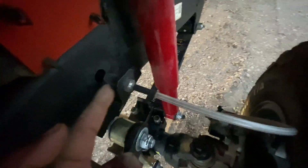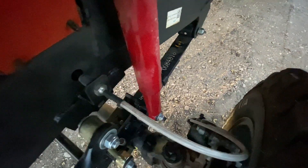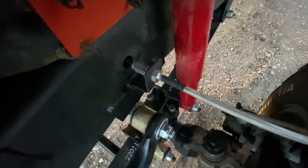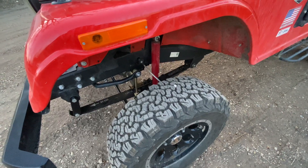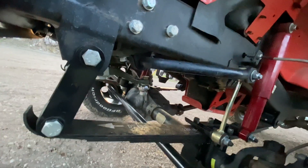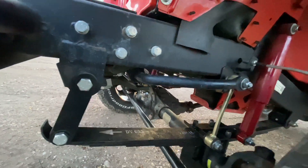Brake lines were a bit tricky. There are two nuts behind here — that first one has to be free and then you hold the second one and you can detach from out here. It took me almost an hour to figure that out. You start by taking that first one loose, then hold on to it and turn the other. Drilling in the frame was easy — that was soft metal — but the pitman arm, I think that's stainless steel. It took me a while to drill through, but I did it finally.